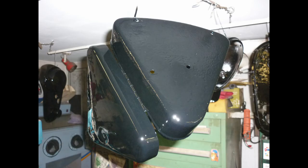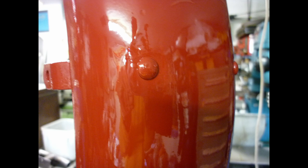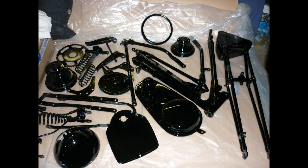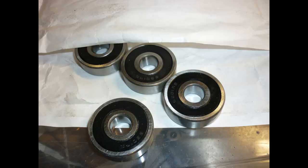It's sprayed outdoors, preferably before the flies get up, because the shiny surface excites them more than it does a concourse judge. In cool weather, I put on some heat to warm the workshop. Parts are hung there, carried outside in turn, and hung back after spraying. Coat 1, a covering mist, is left to go tacky and provides a purchase for later, thicker coats to reduce the chance of runs. Then the workshop is out of bounds until the following day, when parts are moved to a place of safety and left to harden for a couple of weeks, however desperate I am to start bolting things together.